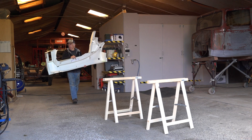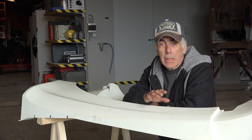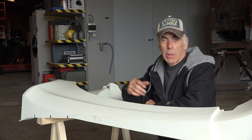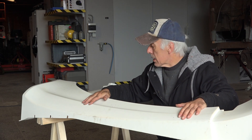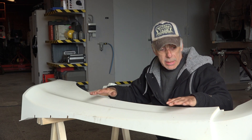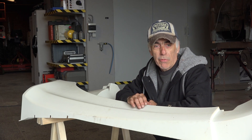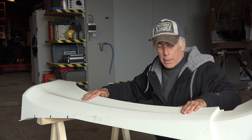In this video we're going to paint the sill of the Lotus Elise. Before we start, I'll take you through all the steps. I have a brand new sill, and we've already seen the old one removed in a previous video. We need to paint it before mounting it back on the car. First, we need to wash it down because it has dust and debris on it. Then I'll wet sand it with a grit of 1200 to 1500 to dull the surface.